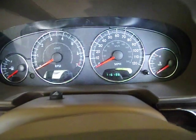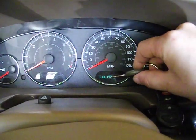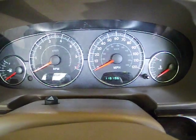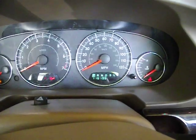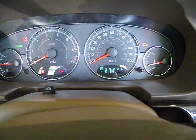Well, I'm going to show you how to do it here quick. If you have a Chrysler with a digital odometer, like we see right here, chances are you can pull codes. Now there may be a couple exceptions, but here's what I'm going to do. Put the key in the ignition and turn it on, just to confirm we do actually have a check engine light on this vehicle, because I induced the code for this purpose.